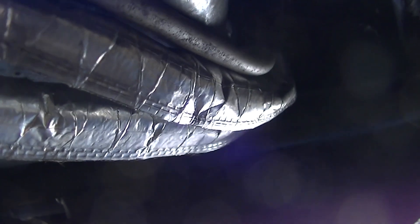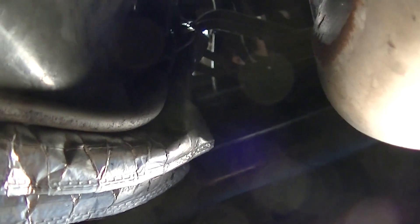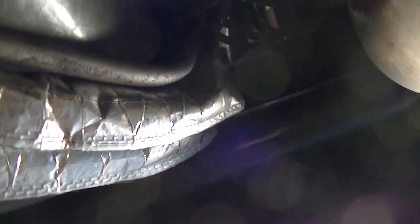This was a truly hard repair. I might go with braided steel stuff next time, or try something else. Right where it was leaking was right at the bend, near that hot exhaust pipe — that's the reason for these little foil blanket things. I would definitely not recommend just doing a plastic or rubber fuel hose with clamps repair there — that's asking for problems. I'm in favor of hard lines and doing it right, though those flex lines look pretty convenient. You still have to support them either way.